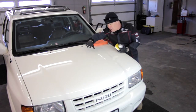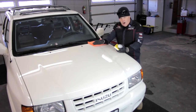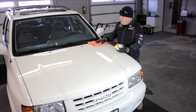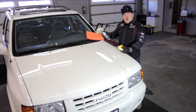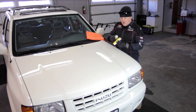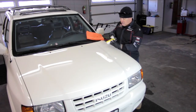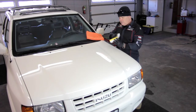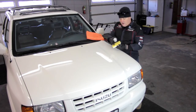What I like to do is start out in the middle of the hood and work my way back, that way I'm not putting my arm over the work area. A lot of people think about spraying the product directly onto the car. What I like to do is shake it up, take a nice clean pad — make sure it's clean, I just took it out of the box — and just spray a light coat over the whole pad. Then I take my clean fingertips and just work it into the pad a little bit, so it's nice and even.